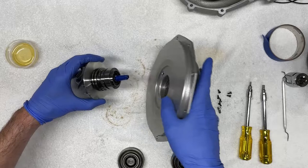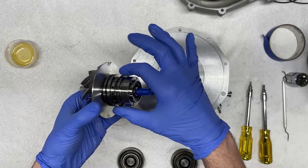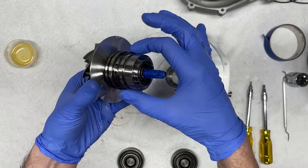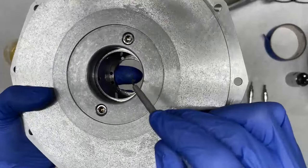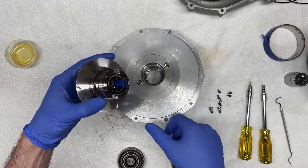That tapping ejected the impeller housing. And this is where you can see a couple of things. You can see one of the oil seals here. You can see an assortment of shims that are added from the factory to account for any tolerancing or any preloading onto the bearings. Those shims either end up on the impeller housing as shown here, or they end up right here, stuck to this housing as well. So those are one of the two locations where these shims typically end up.